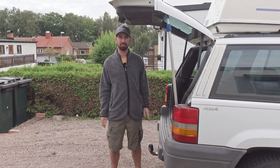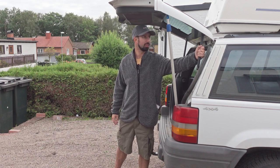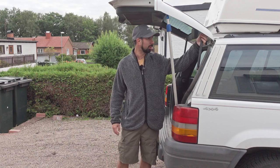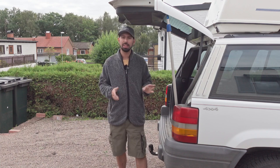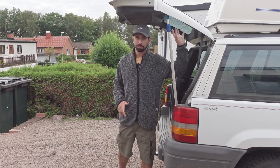Today we're actually going to fix this in a proper way. We're going to change out the gas struts because they are old and they need to be changed out. In this Jeep it's quite straightforward because there's no trim pieces in front of them. This is a Laredo model — on some of the Limited models and similar, you might need to remove some trim.